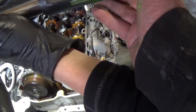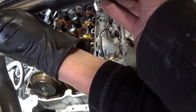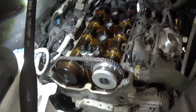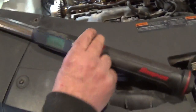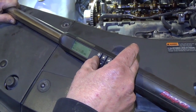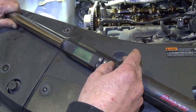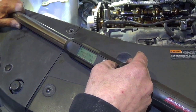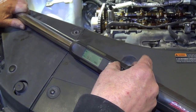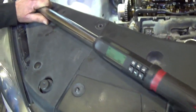And now we need to go 100 degrees, right? Gonna lay it down. Okay. Gonna hold that. You can set it. I'm gonna set it and forget it, right? It's been so long since I've done it. Okay. Angle zero. Torque zeroing. Angle zeroing. There's 90 degrees, right? Very nice. So up to 100. Okay. And now we're good to go, right?